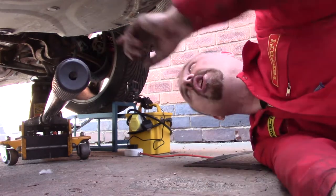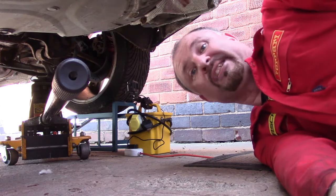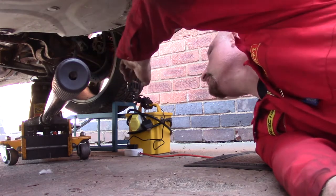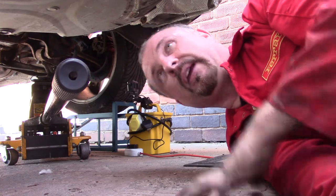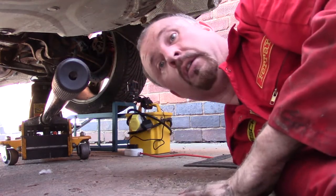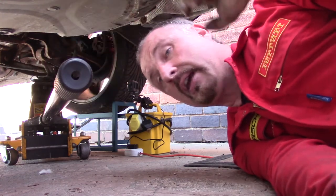So the bolts on the prop shaft are now all loose, all of them, both front and back. That drive shaft, they're all loose. It's just I've got two more bolts on this drive shaft to undo. So I'm just going to jack this up a little bit, turn the wheel around, drop it back down, and undo those two bolts. And then I think I can take the prop shaft out.